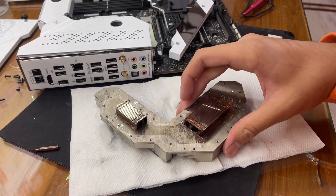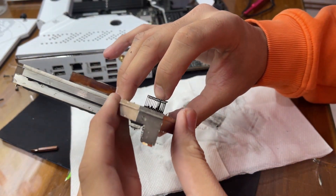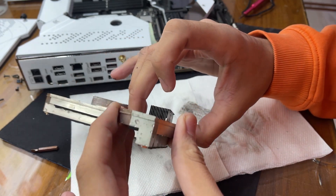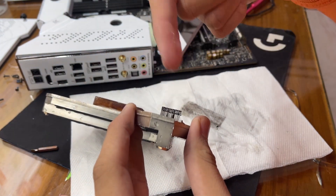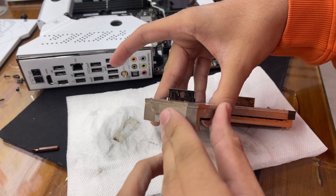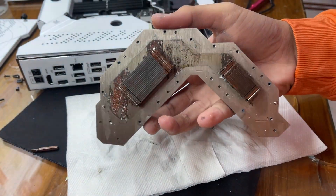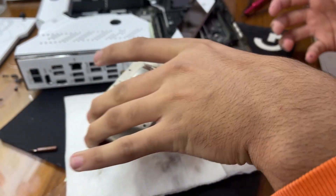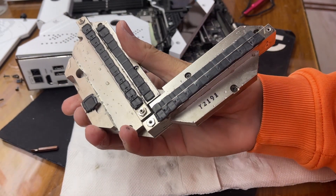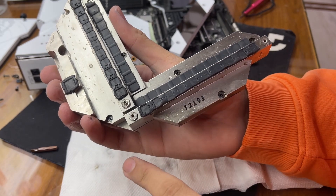So now I actually got that cleaned out. Just another thing I wanted to add: in order to clean these fins — as you can see they are pretty clean now — I had to use a needle to go in them and clean them out. I did the same thing on this side and got most of it out. I didn't actually try using any abrasive materials. If you are doing this and watching this video, please order these thermal pads before actually opening this up.